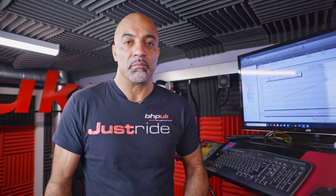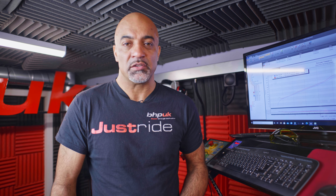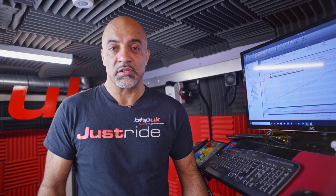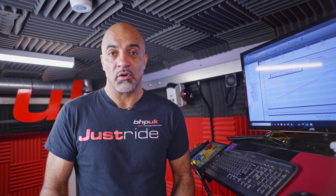It really does feel very different, and obviously it feels different because of what we've managed to do at part throttle. At 40 degrees of accelerator opening, which is just under 50%, the accelerator moves 85 degrees on this bike. It's now exactly where we want the fueling, and as a result of that, the throttle response is going to be hugely different. That's certainly evident on the test ride, and that's certainly evident from the feedback that we've had from the customers.